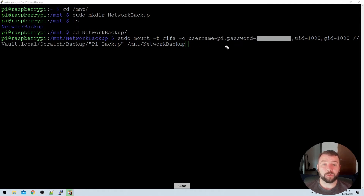The very first option is to specify a username and password to access the network share. We're not going to be mounting it as a guest — I don't believe that's particularly secure, even on your home network. If there is no username and password for the network share, you don't need to specify them here and can just mount it without these options. However, unless you really want everyone on your network to access it, I would strongly recommend setting a username and password.